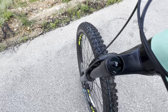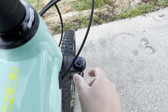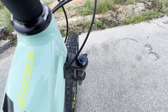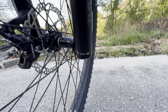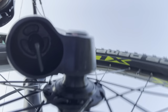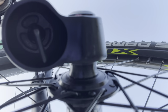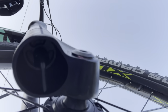This is where the Schrader valve is to air up your fork, and it also has a lockout feature. It has full lockout and various settings in between where you can dial in your compression. At the bottom of the fork there is a rebound adjustment — very poor quality in my opinion. It's just a little piece of plastic that you twist, not a very solid piece of equipment. That is one con I've already found with this bike.